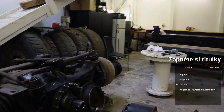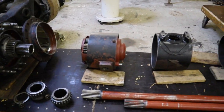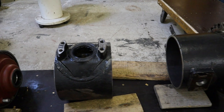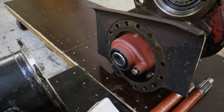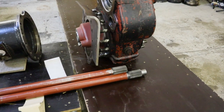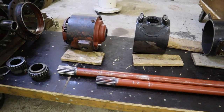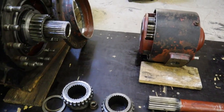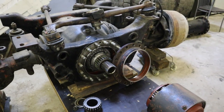Last time I finished the cutting of the main structural tube for the front axle, as you can see over here. I already have it situated the way it will go together — the flange, the differential, the steering mounting point, and the last tube where the locker is, which will disengage and engage the motor. Here are also the original shafts which need to be modified, and these gears — we are going to put one of them on the spline of the front axle. That's what we are going to do first, and then we will check if the differential actually works with the front axle.